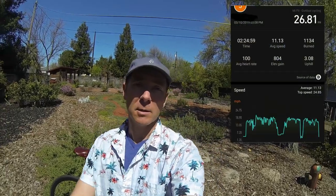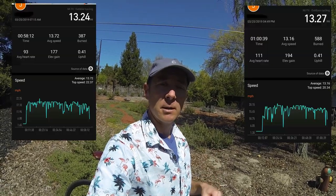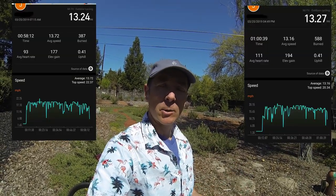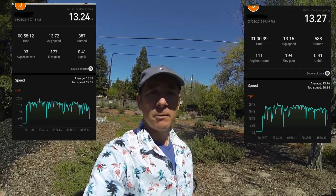Wrapping up the results of my range test on the Volano Core. I did two range tests. One with my son — he's 110 pounds and got 26.8 miles; his average speed was about 11 miles per hour. At 175 pounds, I got 26.5 miles with an average speed of about 13 miles per hour, and I was riding fairly hard. At the end of my son's range test he still had approximately 40% battery remaining; I still had about 25% battery remaining. So range is quite good on this.